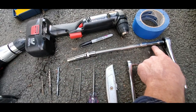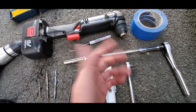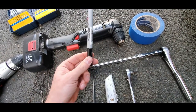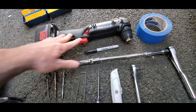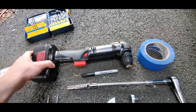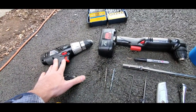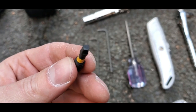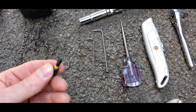To get the gas pedal off you'll need a 10mm deep socket and a swivel adapter, plus some extension bars to get up there. I used a 3/8 ratchet, though a quarter-inch works too. Blue masking tape, a black marker, an angle drill gun, and potentially a straight drill gun depending on how your angle drill fits. You'll also need a square bit to remove the old backing plate from the existing dead pedal and to put on the new backing plate.